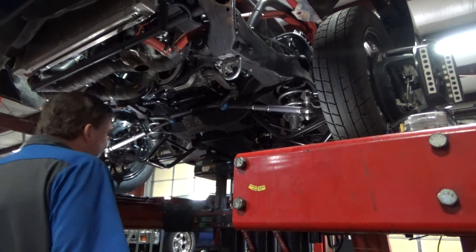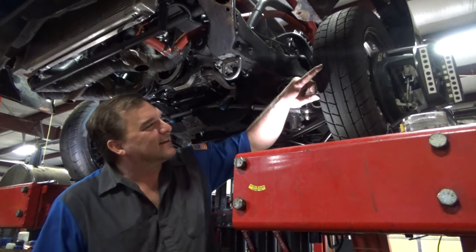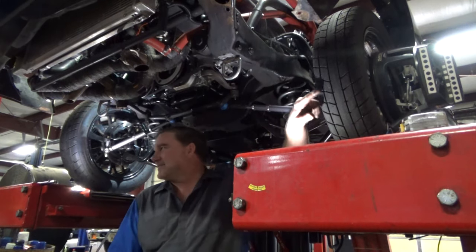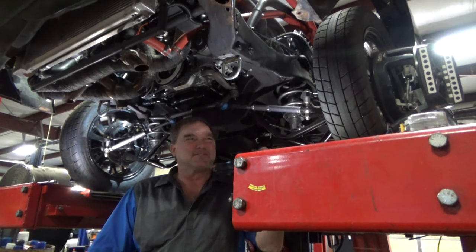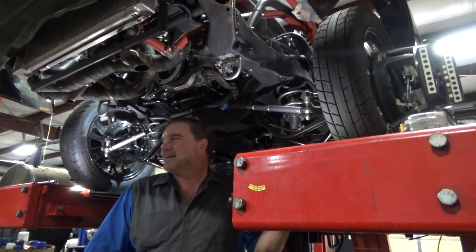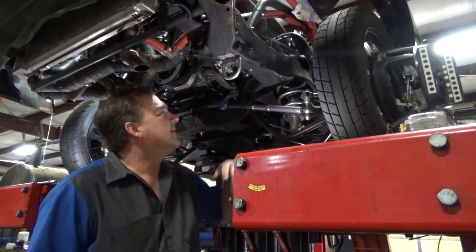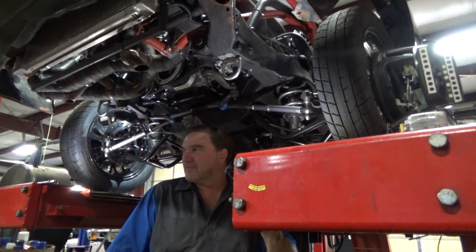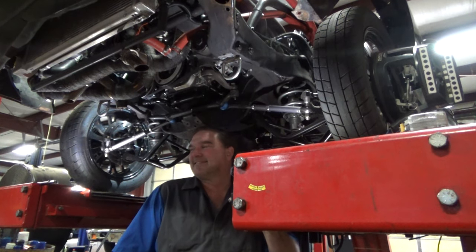Over six degrees toe-in — six degrees toe-in is a bit excessive. I was seeing tire peel over here and I was wondering if it was the tire wearing off, but I think it's just transfer from the street. It's already far improved from when I started. He's going to notice a substantial difference. Six degrees on lift — it's exactly what I told him: six point four on total lift.